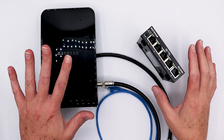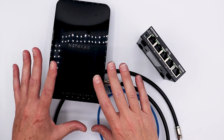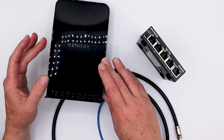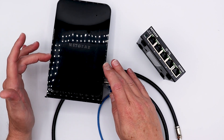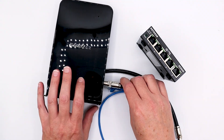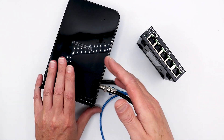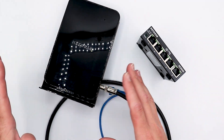On the first scenario we showed you, the cable modem was just a dumb cable modem — it doesn't do anything other than be a cable modem. It doesn't have a Wi-Fi access point, routing, or a switch built into it. Now we're going to play like this is an all-in-one cable modem device — something that you're renting each month — and it actually puts out a Wi-Fi signal and it's got a four-port switch on the back. This one only has the one Ethernet port because it's just a cable modem, but let's assume this is an all-in-one, which would be bigger, but same idea.